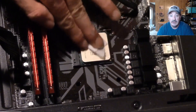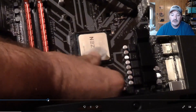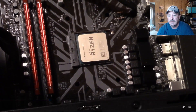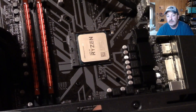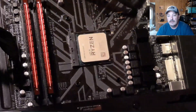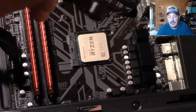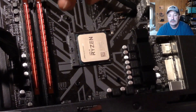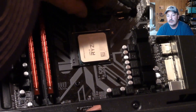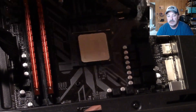Here I'm showing you about the brackets and how to put them back on the motherboard. If you use one of these coolers out of the box, you need to make sure those little black clips are facing the right direction — outward, away from the CPU. If you're building fresh on a new motherboard without a stock heatsink on it, you can skip this step.